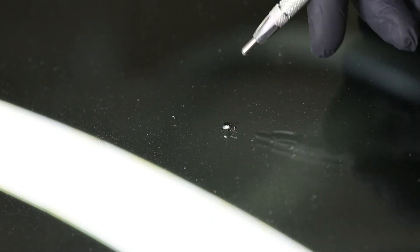Now that we have the pit cleaned out and you can feel that pit area, that's our cue that we're not going to drill this repair — we have an access point in the center of that chip. If you do not have a pit or access point in the center, you will use the drill that came in your kit to drill the surface at the center of the repair to open it up and allow your resin to get into the repair. We'll go ahead and attach our inspection mirror to the inside of the glass and move forward from there.